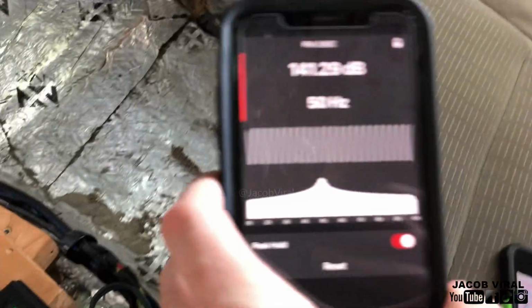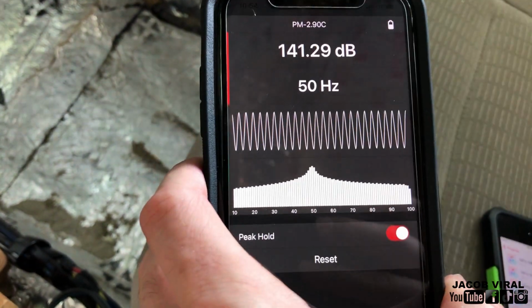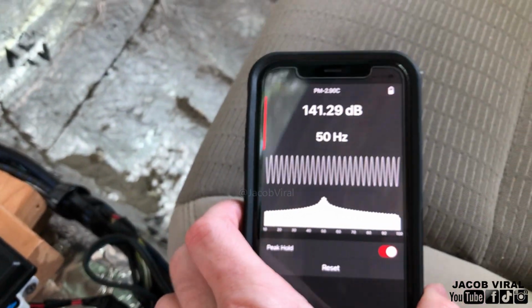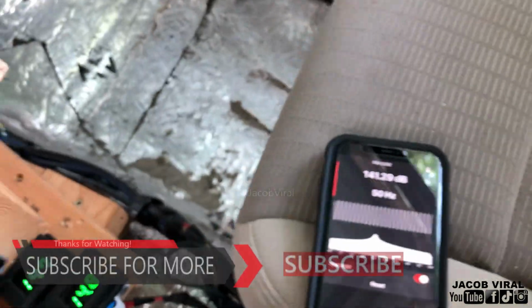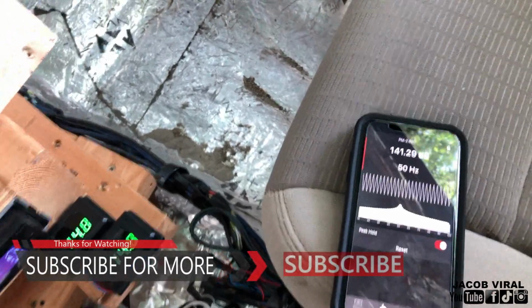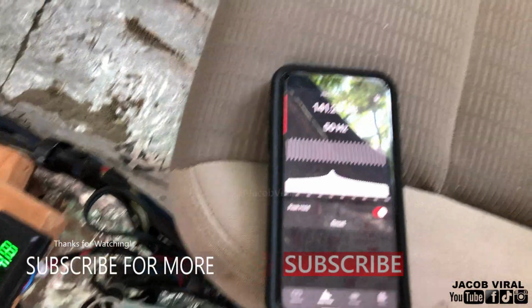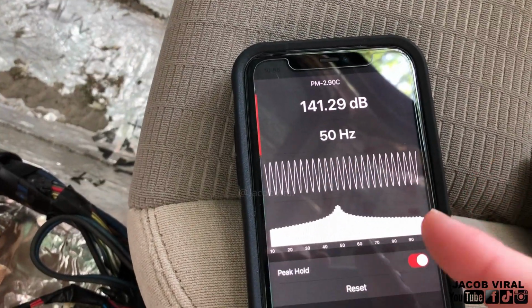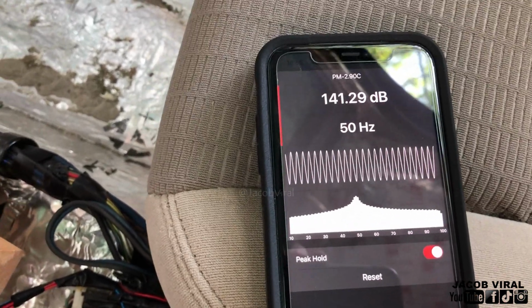So 49 to 50 hertz depending on how my seat is and the weather. So right now it's peaking at that with my seat all the way forward with the window down. My goal is 50 hertz or below. If I burp sealed, it'll be like a 46, 47 hertz sealed, just depending. So I'm gonna go ahead and burp it. Let's do 51 hertz. I'll do 51 hertz since I know it's always at least a peak higher. Last peak was 50 hertz. So 49 hertz where I burped to 50, but this one I'll do 51, and we'll see what it does.